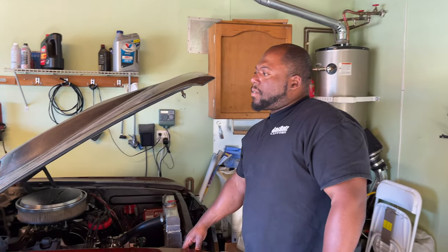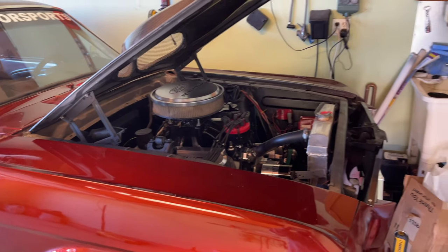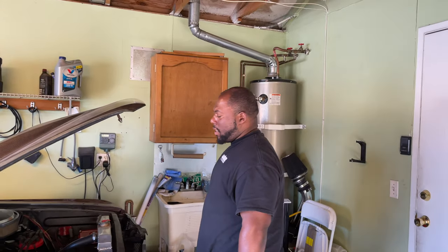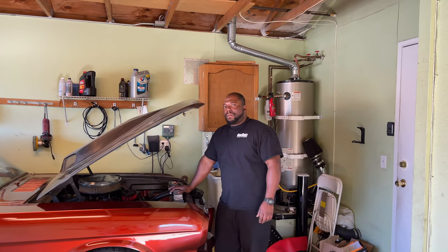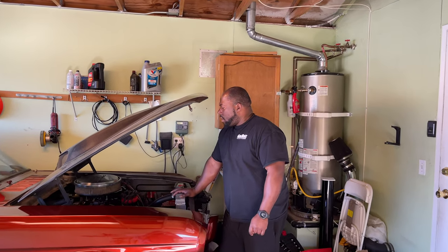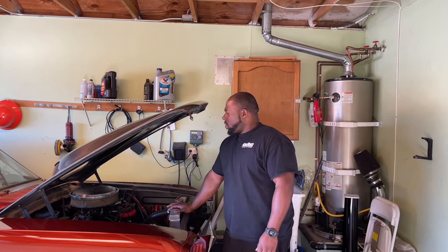But we done tore 2 8-inch rear ends, so we got a 9-inch we're gonna put in there now. We got some rims we're gonna try on. I think it has Magnaflow bullet mufflers. So yeah, it's pretty fun. I think it got 3-inch exhaust too.